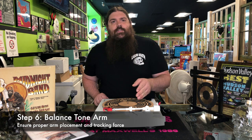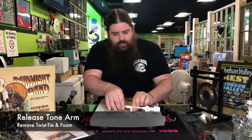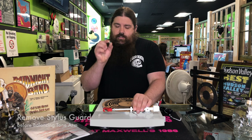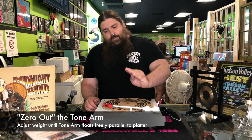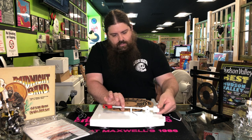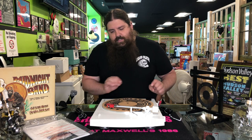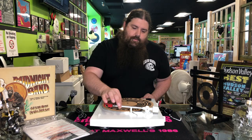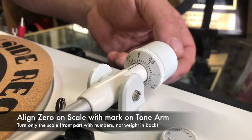Now that we've installed the counterweight, it's time to balance the tone arm. First things first, we need to release it from its long-held sleep with this twist tie removal. They've also protected the tone arm. The first thing you want to do is remove the stylus guard, because this is actually going to affect the weight when you're balancing the tone arm. Next, we're going to do what's called zeroing out the tone arm — finding the point where it doesn't fall up or fall down, where it just floats nice and level, parallel above the platter. Just hold it above the platter, make a few turns and check, finesse it until it's holding its own. Once you've done that, return the arm to the cradle. This scale moves independently of the weight itself — turn that scale so that the zero is aligned with the mark on the tone arm.